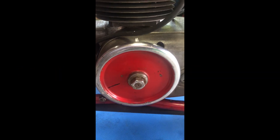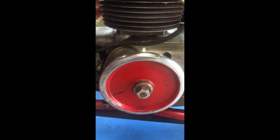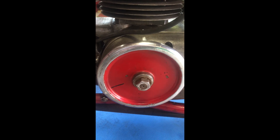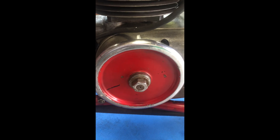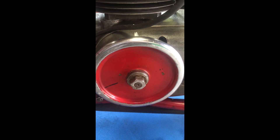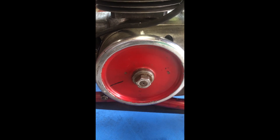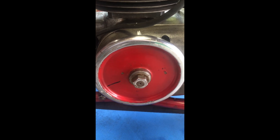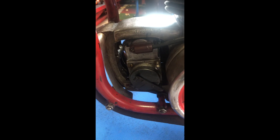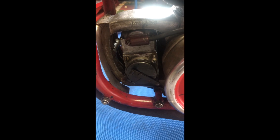Here's the latest update on my little 125cc MV Agusta. She's not been running as well as I'd like. We've done everything with the carbs, but I've now noticed that the ignition timing is not as far advanced as it should have been. I've strobed her up and noticed she's well inside what should be the proper timing for this particular engine. So I need to reset the magneto position.